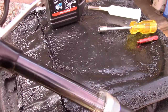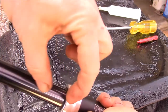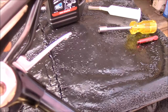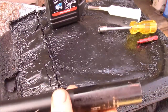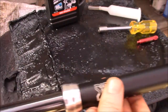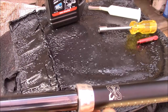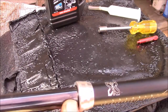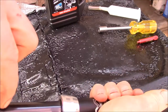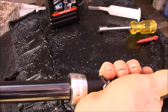The problem I was having is I would pull it up and then as soon as I got on the saddle it would drop down about this far — there was just no way to keep it fully extended. What had happened is over the years the oil inside had leaked out around the seals. It was never a major leak, just a drop every week or two, but over time enough oil had leaked out that it would drop down that far.